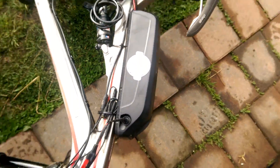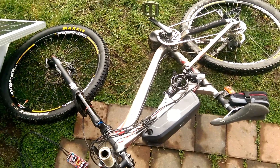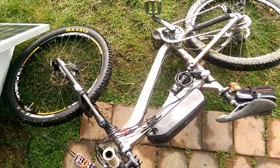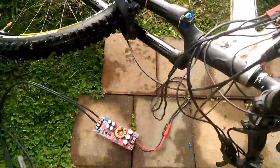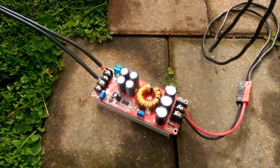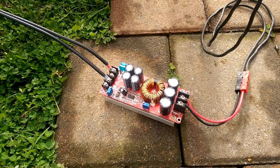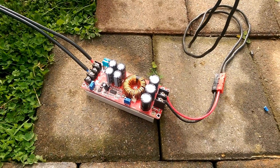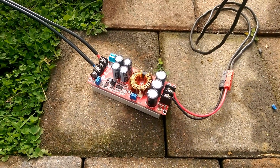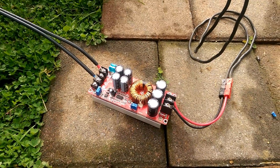At the moment we're on my joint favourite, the Nukeproof — super good bike with a Bafang BBS02 added to it. Anyhow, what I found with that was that this boost converter was really terrible at managing the solar panels. It just drew the voltage right down, and obviously didn't have any MPPT — maximum power point tracking — or even PWM capability on it.